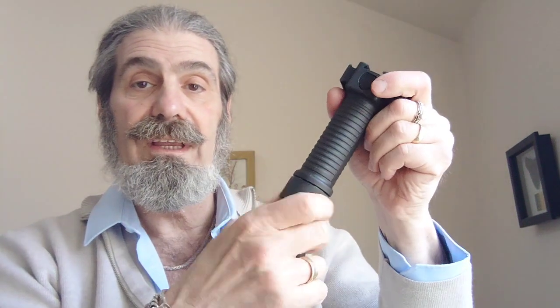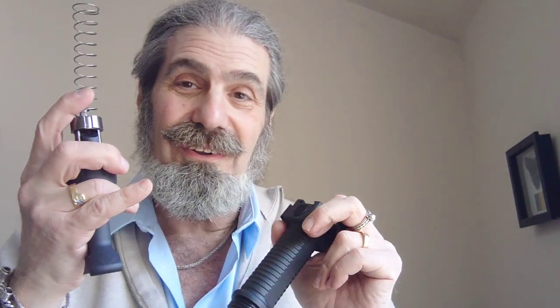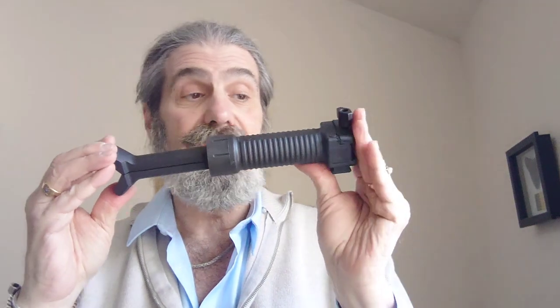If I pop that out, squeeze these together, there is a retaining ring down here. I can unscrew that and take all of this out. Take the long nozzle on your WD-40 or 3-in-1 oil spray and put the least spray at the very base of that to lubricate the part that hooks onto the other side of the latch. As long as that's well lubricated, it'll function.